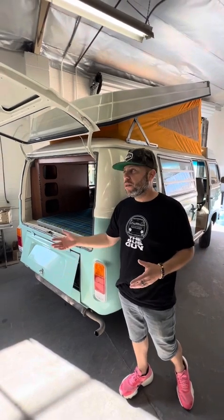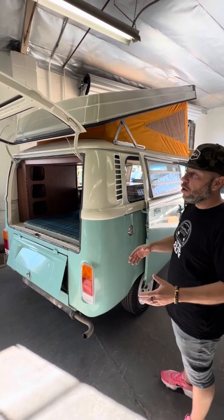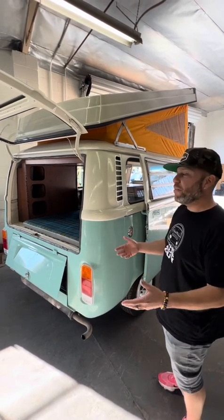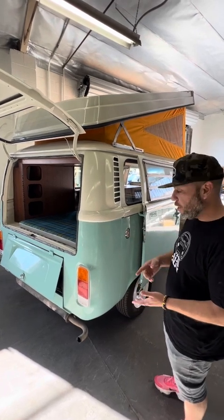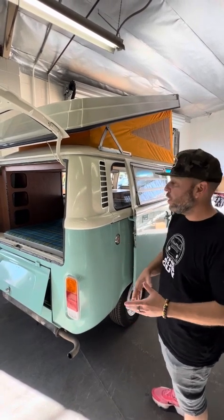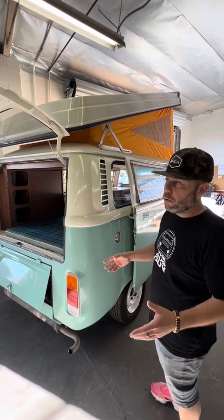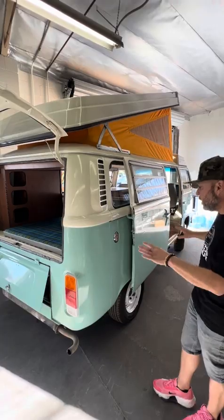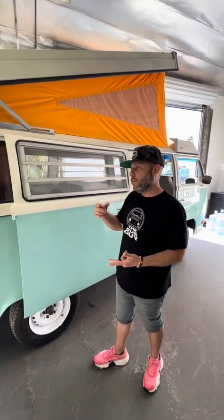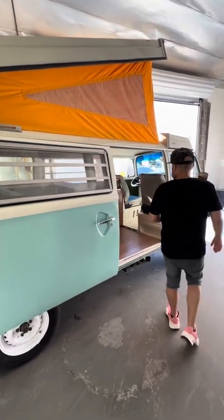Talking about the motor makes me think of the rest of the mechanical work. The brakes, front and back all around, are all new — we basically take everything out and put all new systems in. The back has new pads, new brake cylinders, and the drums are replaced or remachined as needed. The front has new disc brake calipers, a new brake booster, and a new e-brake cable — all done, fresh, and new. On the electrical side: the horn, headlights, tail lights, wipers, blinkers, hazard lights, and the dome light are all covered.